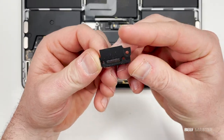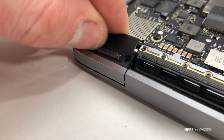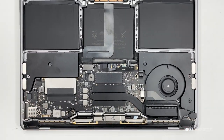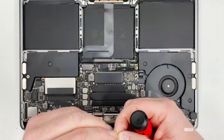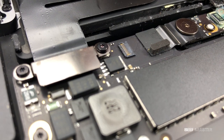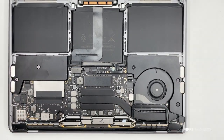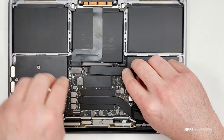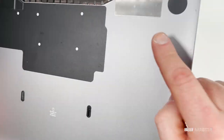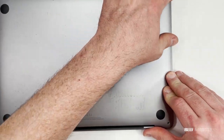The next step is to put on the plastic hinge covers — they're shaped for the right or left side. To put them in correctly, tilt at an angle and they'll lock right into place. There should be four screws to tighten them down. The final step is to connect the battery. Grab a T4 bit and the large screw that covers the battery plate. When you put in the ribbon cable, make sure the latch is open — use a pry bar to lift the latch, then carefully guide in the ribbon cable. With the battery connected, you now have power running through your MacBook so be careful not to short it out. Put on the protective cover. Now put on the back panel: match the back panel with the grooves then slide it into place. You'll hear it click when it's set correctly — work your way around applying pressure until you hear everything click in place.